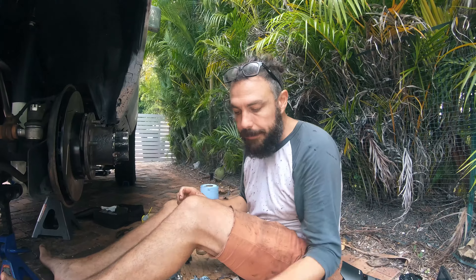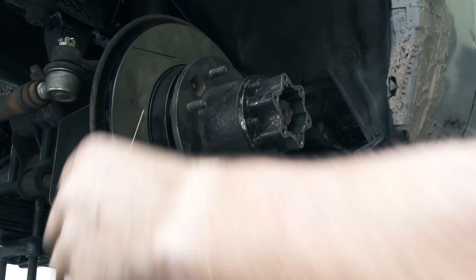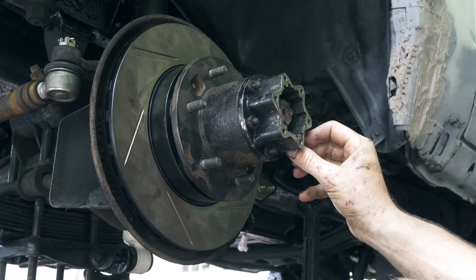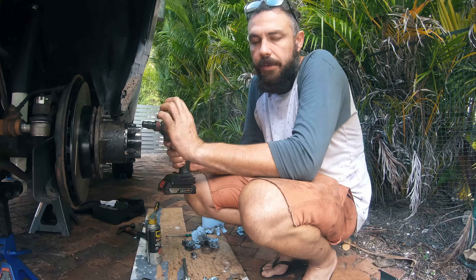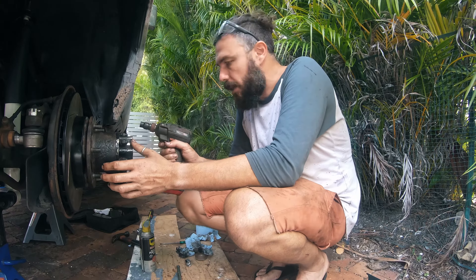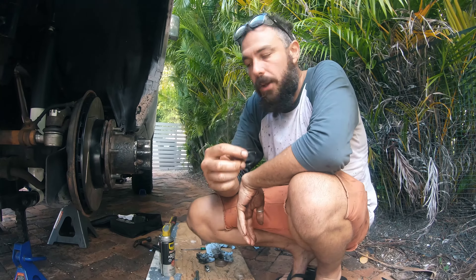She's on. Doing everything in reverse — the cone washers go first, lucky Sophia's here, she remembers all the names for everything. Then you have your little lock washers, and then you have your nuts. Using the 12 millimeter socket I'm going to do these up. Yesterday when I was doing the other side I had the drill on high power and it actually spread a few of the split washers, so I'm going to turn it down today and take it easy — I might even use a hand wrench.